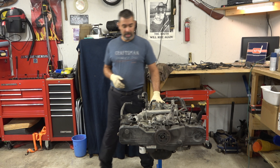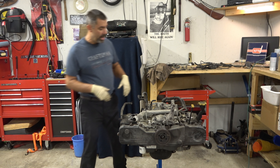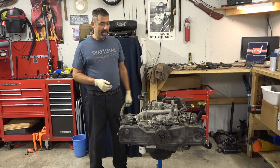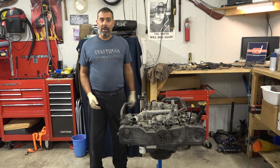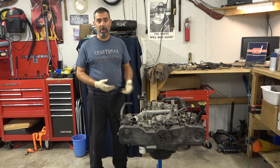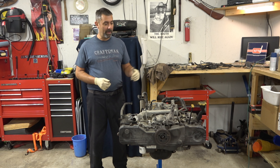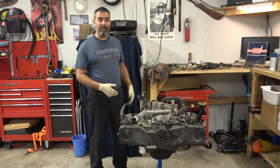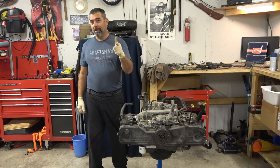The next thing I'm going to do is start pulling my front covers off to expose my timing belt, get all that taken care of, make a bunch of marks, and then we're ready to pull off our valve covers and take off our head bolts. This job is not terribly long. I'm not going to film the whole thing — there are so many videos out there of people doing this. But I wanted to bring you along on what it is I do here on an average day at the Farpoint Restorations part of Farpoint Farms.